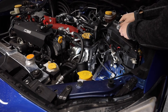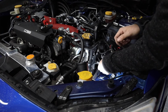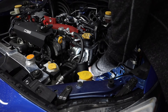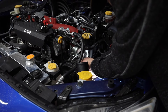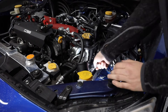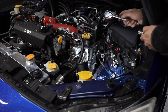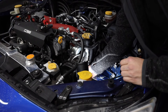The best combination I've found to do this job is to take your spark plug socket, stick a one-inch extension on it, feed it in, and then get the ratchet on. I always make sure I'm loosening prior to going in so I'm not stripping out spark plugs. I'm going to jump on the front one first since it's right here. As it comes out, I like to pull the tool out, take off the ratchet, and then put the spark plug socket back in and do the rest by hand — it gives a lot more room to pull it out.